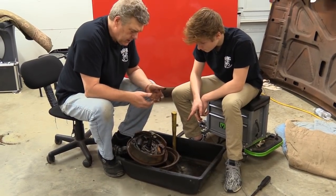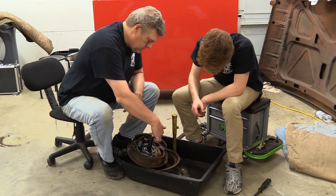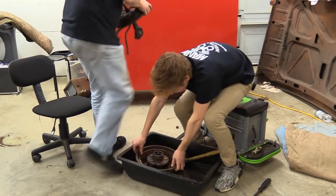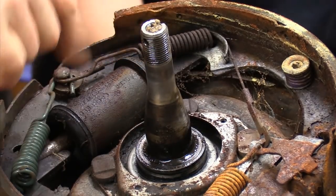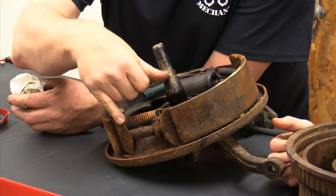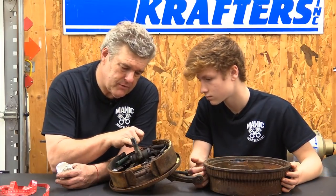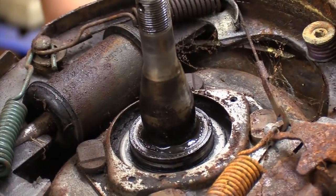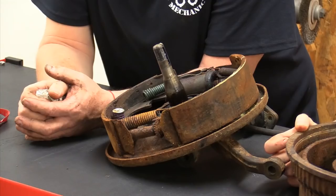We're going to put these up on the table so I can go over what I like about the way these feel. After I've cleaned this off, it's got a little bit of race wear on it — you can see where the actual bearing sets sit on here. Usually the bottom side is where you see the most wear. There is some wear there, but it's low-mile wear — this thing has not seen a ton of miles. There's a little bit of damage where it's taking some of the lighter finish off and burnishing it to a darker color. If the other one looks this good, that's probably the nicest set of '65-'66 Mustang slash '63.5-'64.5 Falcon spindles I've ever seen.